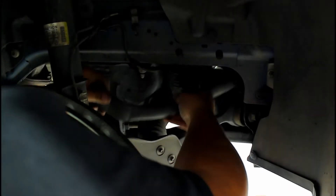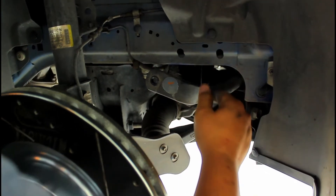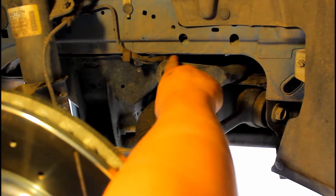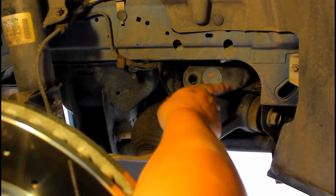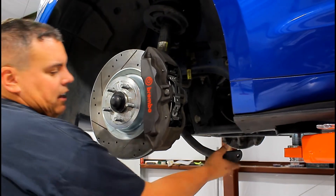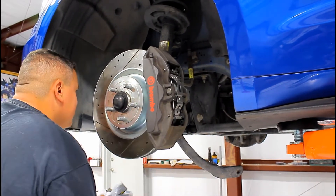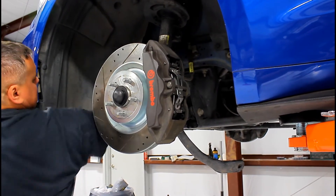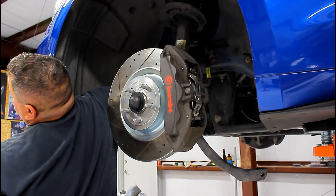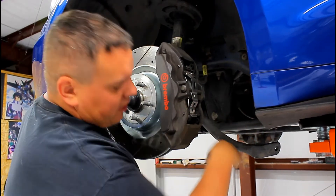I'm gonna start on the passenger side feeding up the sway bar until it stops moving. Then we go to the driver's side — wiggle the other side while rotating it so it clears the opening. Once cleared, feed it some more and pull it the rest of the way from the driver's side. You can see the bottom end is sticking out, so wiggle around the radiator hose — the little mounting bracket is hitting the radiator hose — and pull it down this way.